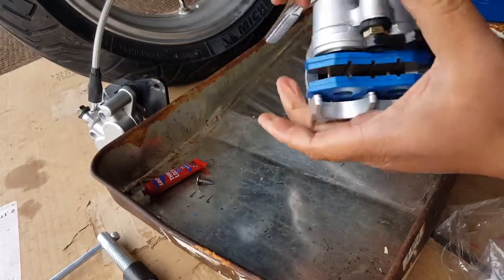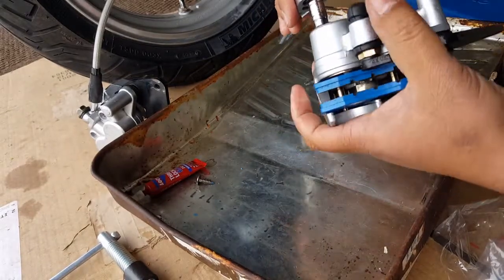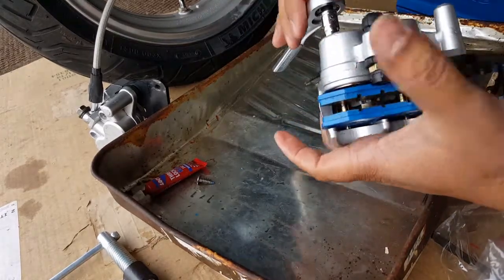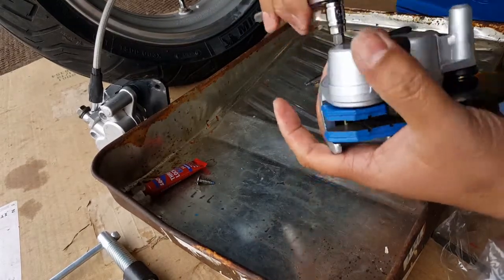just take out your brake pads to change them, pretty much. And you can clean it, get brake cleaner, clean everything out thoroughly. Make sure you smash this all the way in with a C-clamp like I did. Makes your job so much easier.